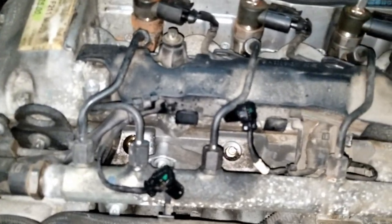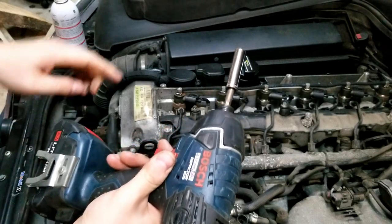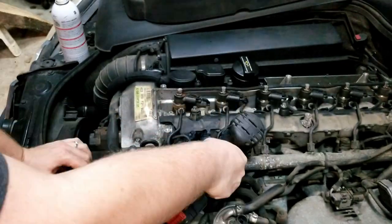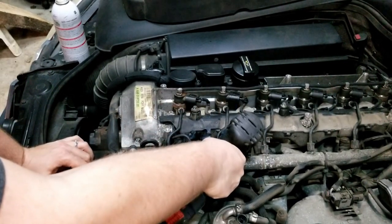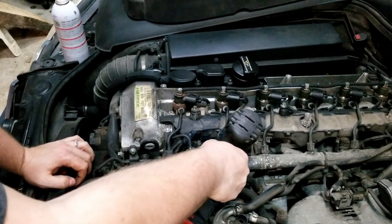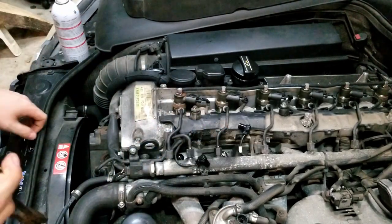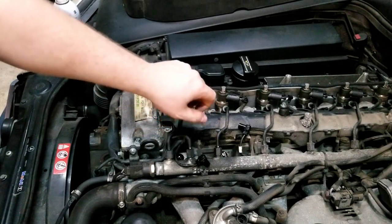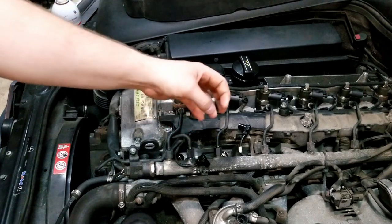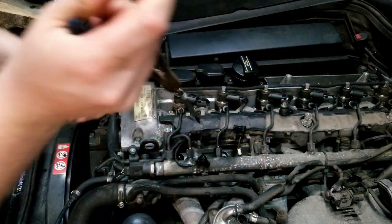The next step is the impact to pull the plug out. The best tool is a quarter-inch drive electric impact with a 10mm quarter-drive deep well socket — that is the ticket for fitting the tool in there. A little bit of impact and the glow plug pulls right out, no problem. Once it pulls all the way out of the threads, let the impact free-spin to ream out the hole a bit and free the glow plug from carbon, so it can be pulled straight out.